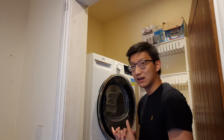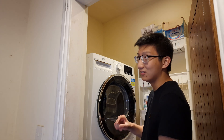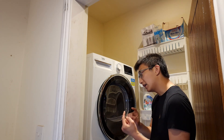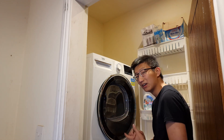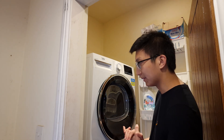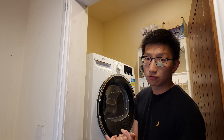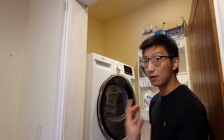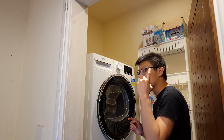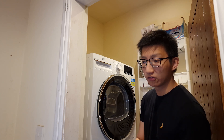I also have a battery that can output 2.6 kilowatts. The heat pump tumble dryer, on the other hand, is rated at 800 watts — I measured it at around 830 watts. This means that under any condition, whether outputting from solar panels or the battery, this tumble dryer can be run at all times regardless of solar output, meaning I can utilize much more of my solar power for drying clothes.